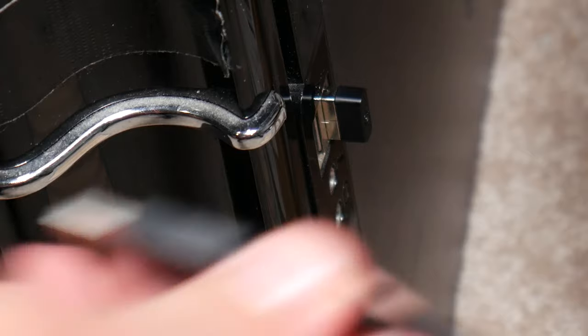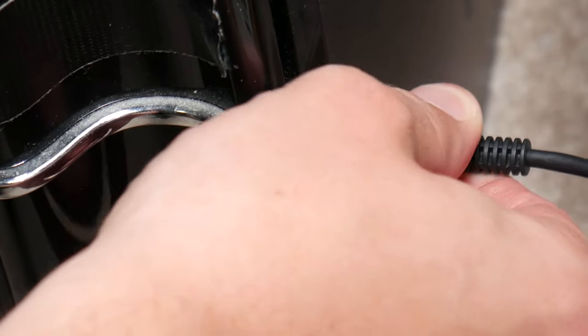What you really care about is what's inside. This is a condenser microphone with a digital output to mini USB that connects to your computer via Type-A USB — no audio interface required. The pickup pattern is a standard cardioid pattern. It has a sample rate of 44.1 kHz at 16-bit and a pickup range of 40 Hz to 18 kHz, unlike other Blue microphones which have a larger range of 20 Hz to 20 kHz.